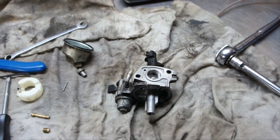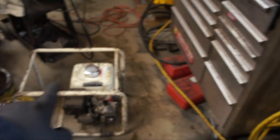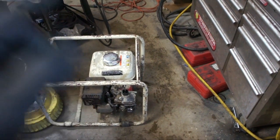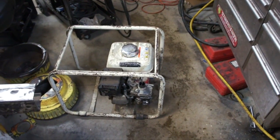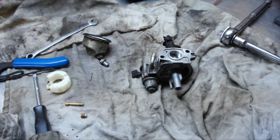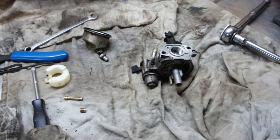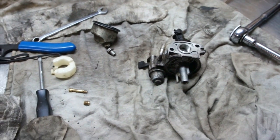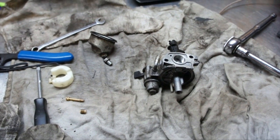So why was it only running with the choke on? Remember there are a few things: bad gas could be one, and that fuel tank cap was plugged — as I showed you, when closed it wouldn't allow fuel to pour down freely. We've got some other things to figure out: is it something internal or just fuel related? Post your questions below on what you think, and we'll get to that in the next couple of videos. Thanks for watching.